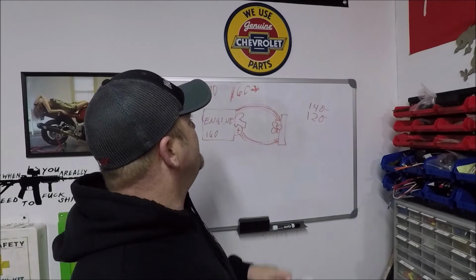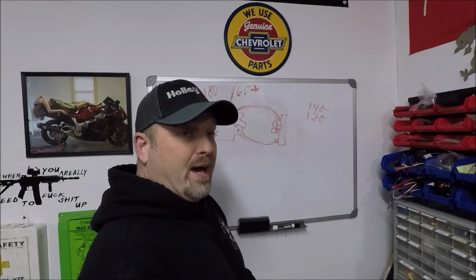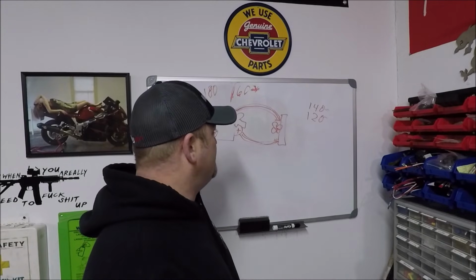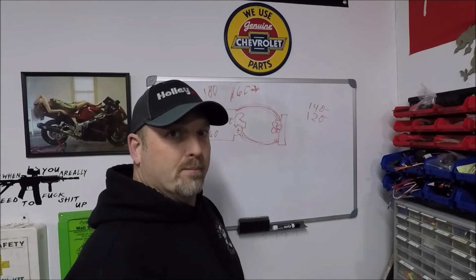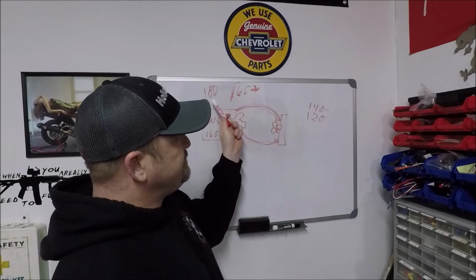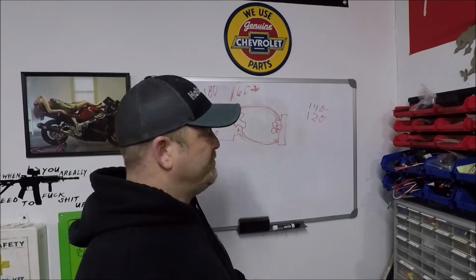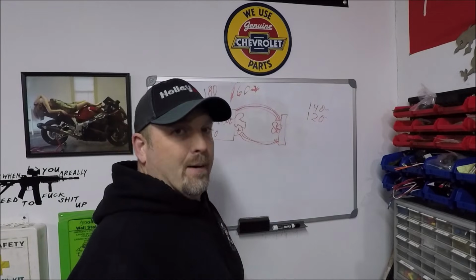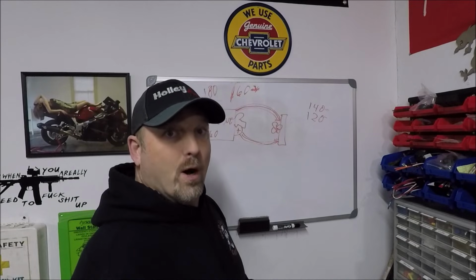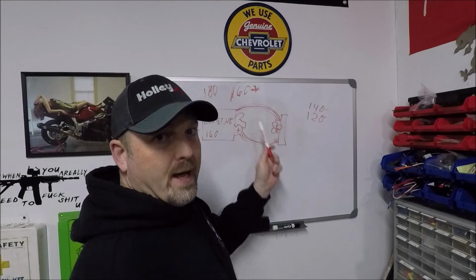And trust me, if you put one of these in it or you remove it altogether, the first warm day outside, you're going to figure out that the thermostat wasn't your problem. Okay, so my suggestion is identify the problem and go from there. But yeah, if you're doing this for performance, I personally recommend a 180. Okay, very rarely would I recommend a 160. I'm about to use a 160 on this car because Zane was nice enough to send us one, so we're going to try it out and see what happens with the new aluminum radiator. But I generally do not recommend going that low.